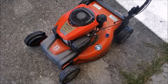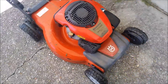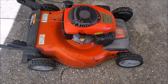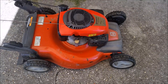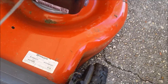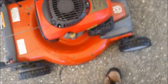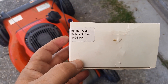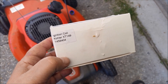Here's one of the day's projects. The mower decides it does not like to run occasionally, and after doing some research online, somebody told me the problem is the coil has gone intermittent. I'm going to take the top off and show you how to change the coil. That's the model and brand number, and there's the ignition coil part number — I bought it off eBay.